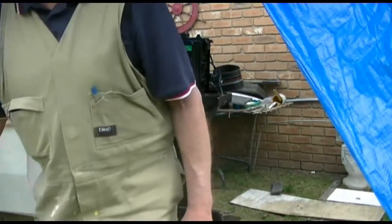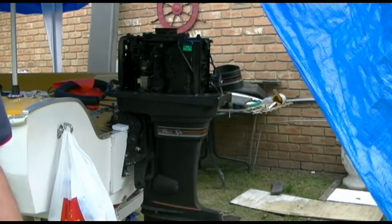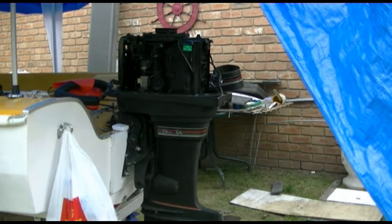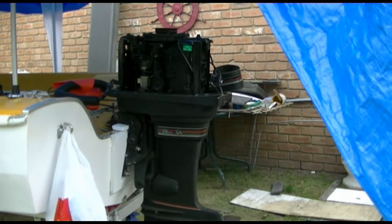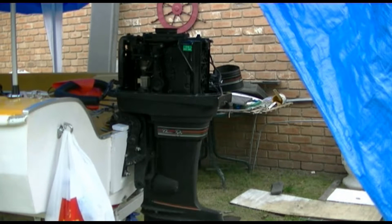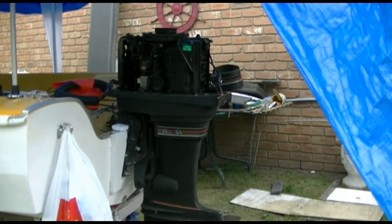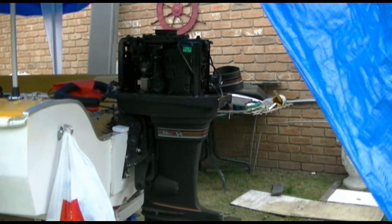That seemed like a flat battery to me. I said it seems like a flat battery because I've purposely left it standing on the bench untouched for a month to see if it was any good, and all this time it was always showing 11.3 volts. Now I'm going to get the charger and put it on that for a while. Might be enough to get it going.